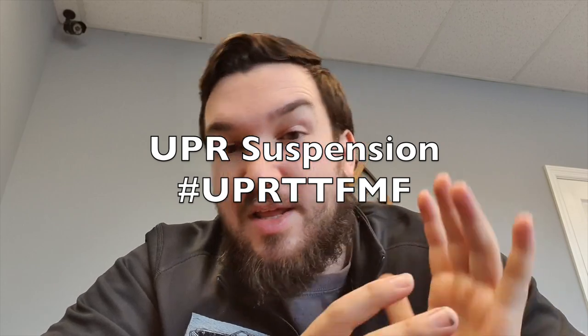I'm actually putting a Spec super twin disc into my 363 build. After that, I just had an aluminum driveshaft — a big thick aluminum driveshaft. I had 4.10 gears in the rear end with a full spool. It was all braced with UPR bracing and had the axle tubes welded — pretty much battle ready. I had lightweight wheels on it, frame connectors on the car, torque box reinforcement kit, and all that kind of stuff. So there was some money in the car; it had good suspension. A lot of that's still in the car and is going to be utilized in the next build.